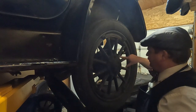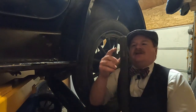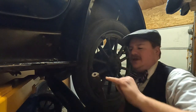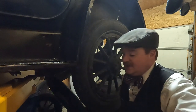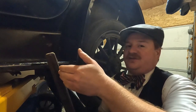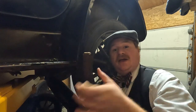So these six nuts here are what hold the axle in, and it'll literally just slide all the way out. At the end it's got the splines — these are massive old-style square splines. You can even see how they cut them, probably on a horizontal mill, Brown and Sharpe if I had to guess. You can see that the cutter came in and then it tapers out — they were cutting them in this fashion with a slotting cutter to make that square spline, which engages with the spider gear inside the differential.